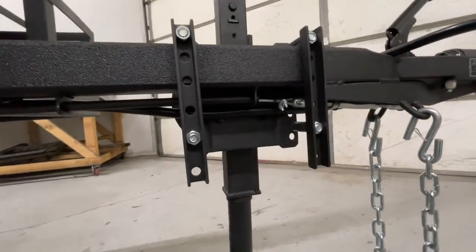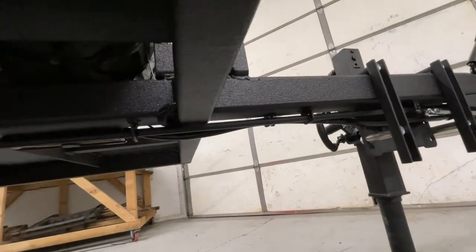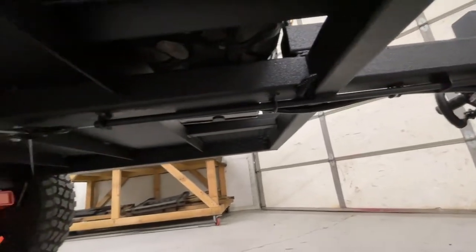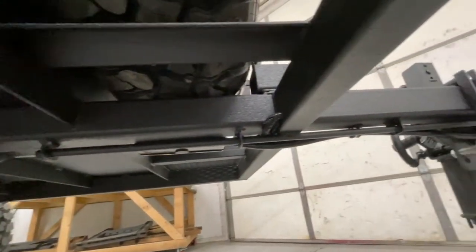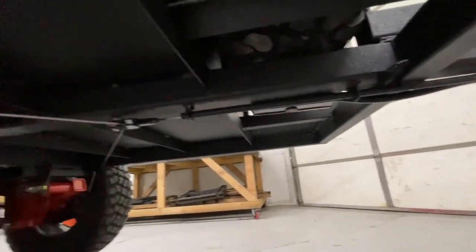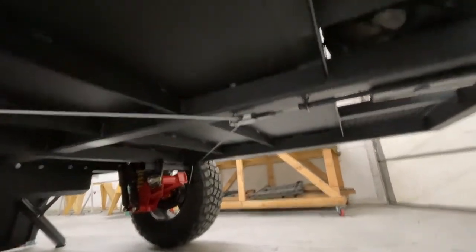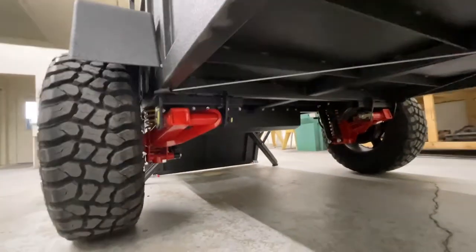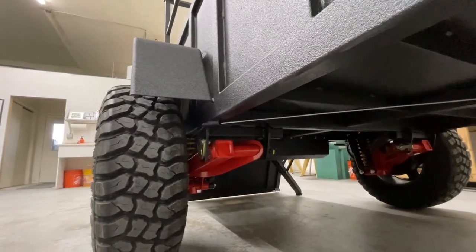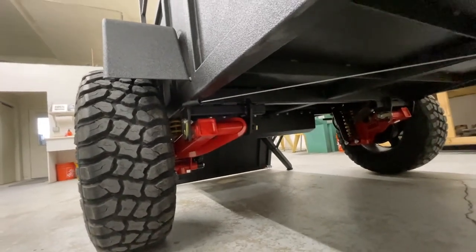With how my trailers are built, I had to do a little bit of different work to apply this emergency brake cable. I used a tube to protect that one cable and modified it. Then I built a little pulley for the handbrake, and it also needed a little channel right there in that corner to direct the cable so it stays out of the tire.